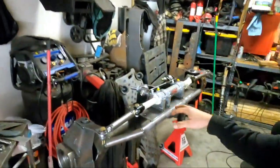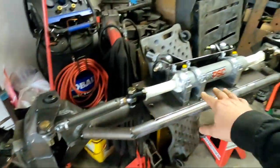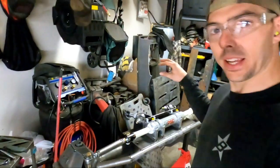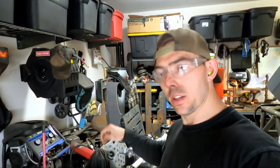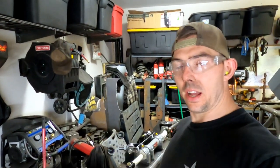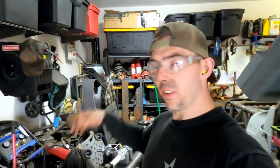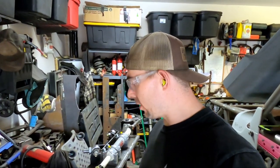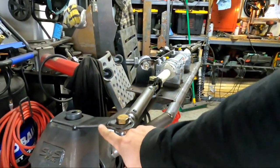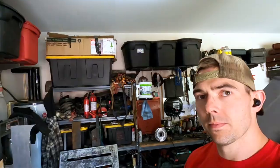I made a template, cut it out, put a bend in it, and installed our high-steer arms and ram — everything is just tacked in place. I'm going to put the unit bearings on both sides, drop it under the chassis, get our links built, flex everything, and get the coilover mounts installed. We'll throw the tire and wheel on and flex it out to make sure there's no interference. If everything works out, we'll have a good fun-filled day of welding and then add double-shear brackets and supports on the steering knuckles.